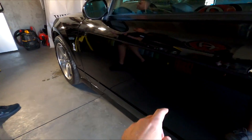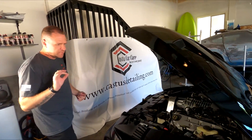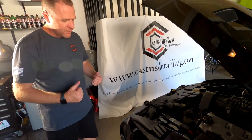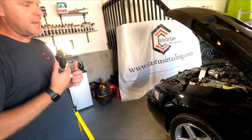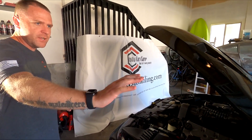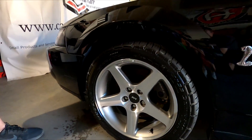Then we moved on from clay to polishing. Some areas like the hood had a thin layer of clear coat so I was very careful with that, but polished everything on the paint and got it shining really nice. After we polish it, we ceramic coat it — I used Adam's Graphene ceramic coat and it lasts up to a year. I put a coat on and what that does is repel water, make it way easier to wash the vehicle, keep it looking brand new, and protect that clear coat.